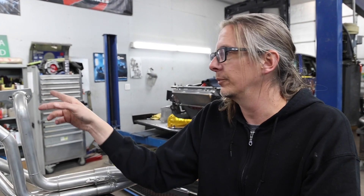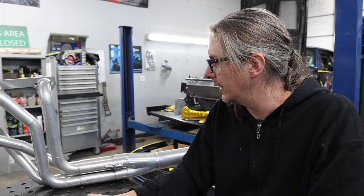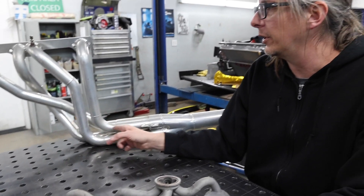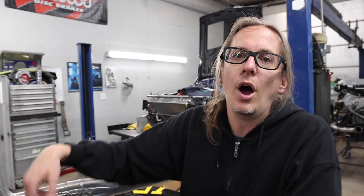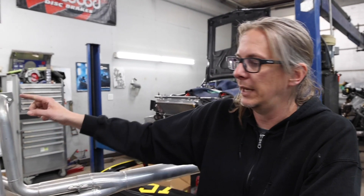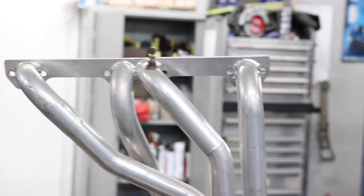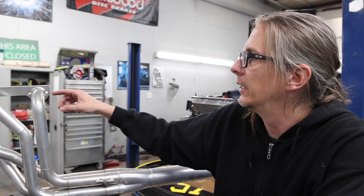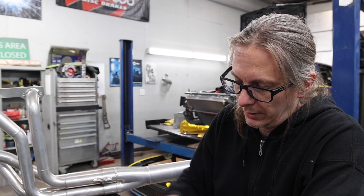One thing that a lot of people do to get that pressure differential with a header is really tune the size of the primary tubes, and some of them you'll even see where they step them so that they get larger. You can kind of see a step in this header here, and where you put those steps can lead to a little bit of an expansion at that area, which can help try to draw air through. You're trying to kind of keep that pressure as low as possible, increase that pressure differential across the cylinder, and pick up a little bit of power. You can also see how much larger, even in this normal header, the primary tube bends are, and that allows for a lot better flow coming right out of the cylinder head. You're going to have a lot less pressure build up on the backside trying to go through that tight turn than you would with a manifold.